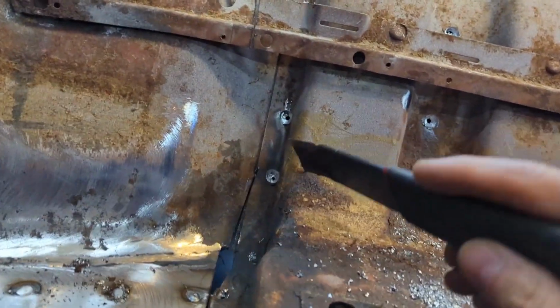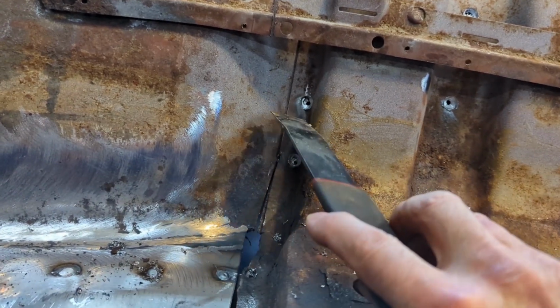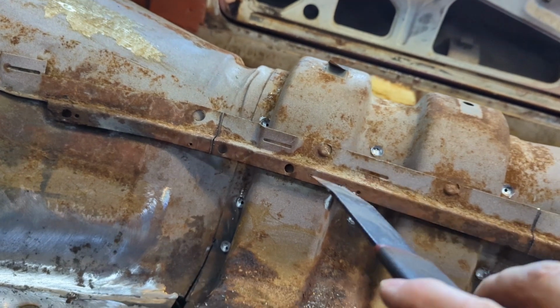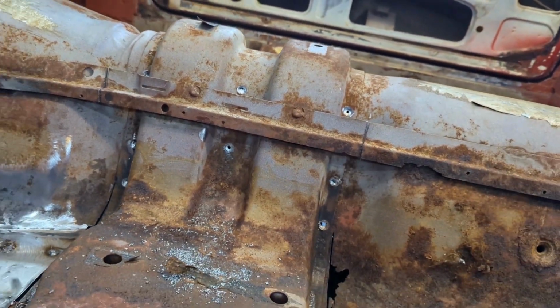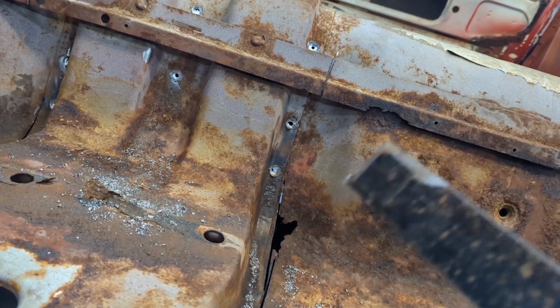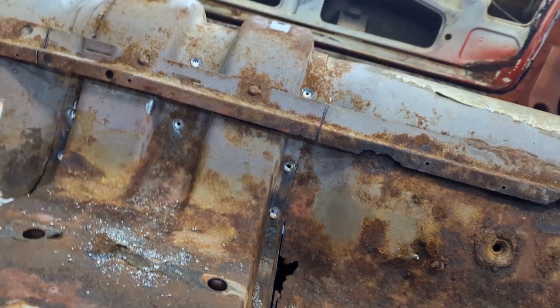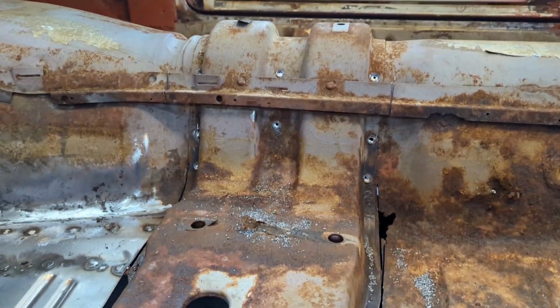Oh yeah, no, the same deal with all these MIG welds or arc welds, whatever they put in there for these. I had the 3 steps, 1/4 inch, 3/8, 1/2 inch. Goes well. You can almost hear them, the couple of them actually, when you use the 1/2 inch bit, you'll hear it snap. They've released, you know they've released. And you know what? Just weld the holes back up and go from there. So alright, that's half of it.